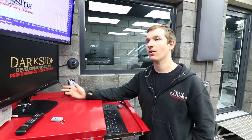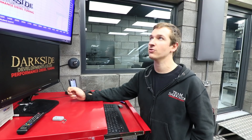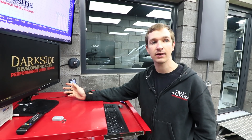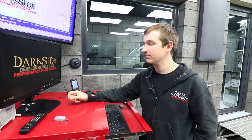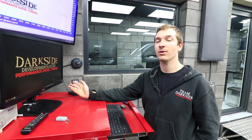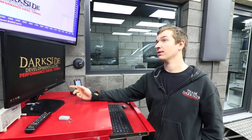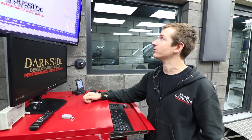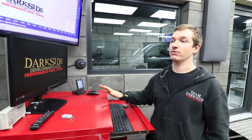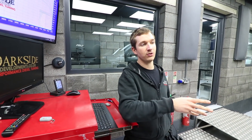It would be nice if we'd thought to put some sort of cylinder pressure monitoring on there, and maybe a flow meter on the crankcase vent, to see how much we're actually pushing through - that should tell you whether it's bedded in or not. We do have a video coming on how to bed in a brand new engine when Steph's Caddy's done. Anyway, the next video we might just take it on the road and do the 0-60 stuff, or do the DPF delete and get it back on the dyno.